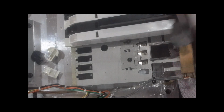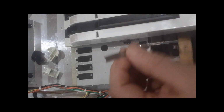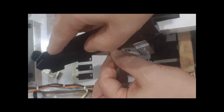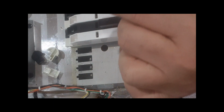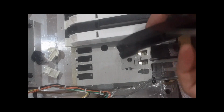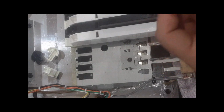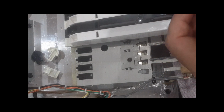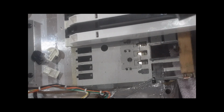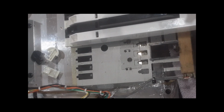And remember, because we're face up when we're putting it in the key, you want the black part face down. So sometimes it's easier to put the spring in first, and then underneath this little tab here, there's a hole. See? And then there's a slide. I don't know if you can see it, but the slide here. And the spring gets caught on that slide. So sometimes when you're putting it in, it's caught. And then you actually hear a snap, that's nothing damaging. That's just the spring getting back in position. And there's a little window here on all the keys that you can see that the spring actually made it up to its final position.